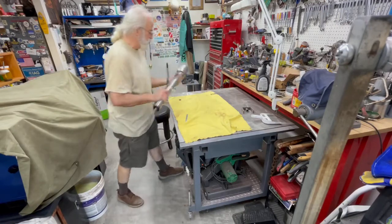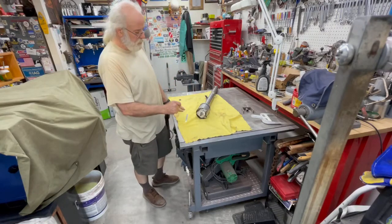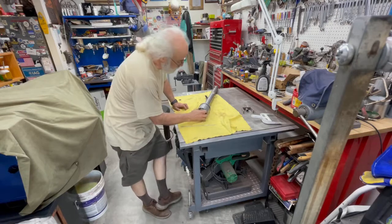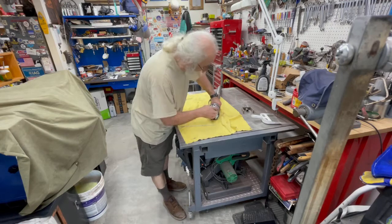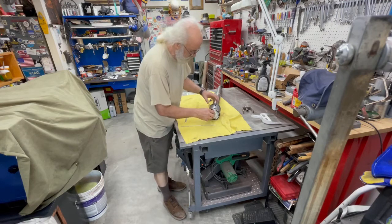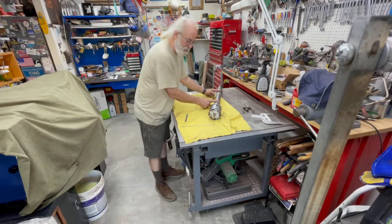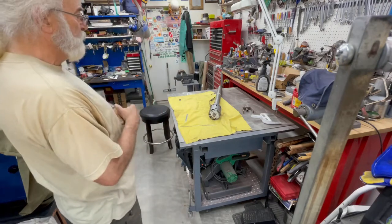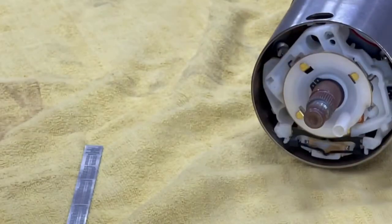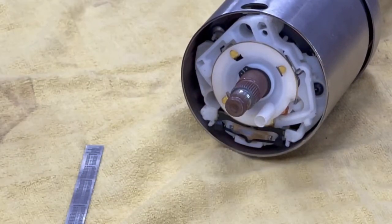First operation is, we have to disassemble this entire steering column. Take all these switches and, you know, turn signal switches and emergency flasher and all that mechanism out. Disassemble the tilt mechanism and separate the two halves of the steering shaft, because the only half I'm concerned with is the bottom half. Yeah. Should be fun. So we gotta gut it out. Stand by.